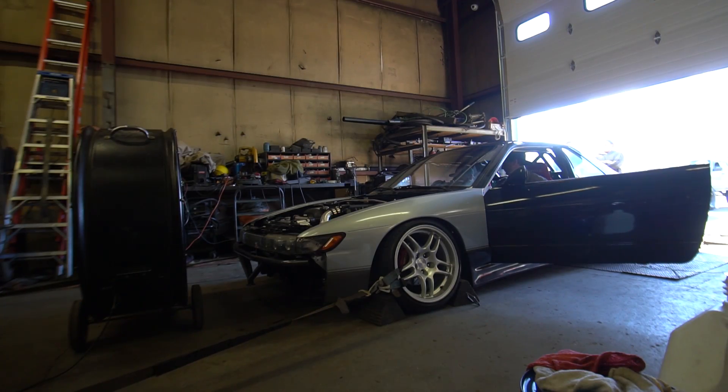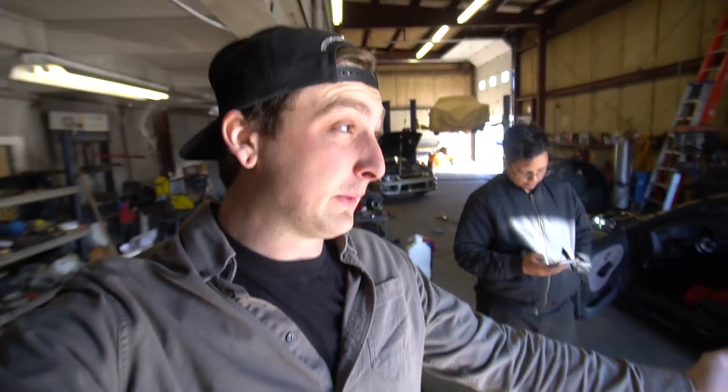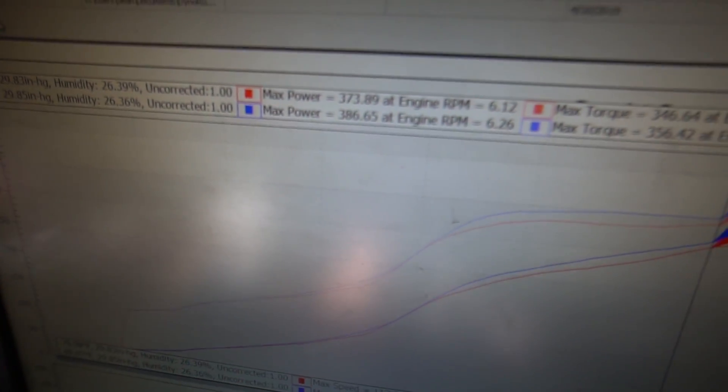Now we're going to throw a little bit of timing at it and see if the engine on the E85 will accept it and pick up some more power. We actually went down a PSI — went from 15 to 14 PSI and it still picked up about 10 horsepower almost everywhere, which is good. Since it lost a pound of boost, it realistically picked up around 20 horsepower, assuming 10 horsepower per PSI. So it's pretty damn good.